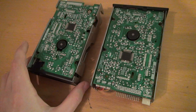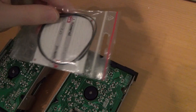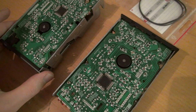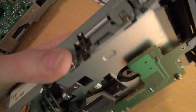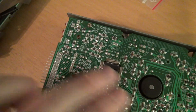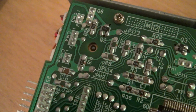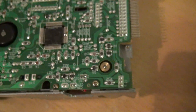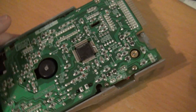I have two of these rather exotic floppy drives here. They are both bad, and in order to replace these drive belts I will have to lift the PCBs. But before that I want to show you real quick how to diagnose that that is really the problem. Here you can turn the little drive wheel which drives the floppy disk, and by watching the motor — this little piece of brass — if it does not rotate, you know the drive belt is bad. Here you can see nothing turns, so that just means the drive belt is bad. That is a common problem for these floppies.